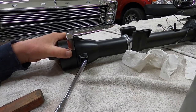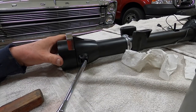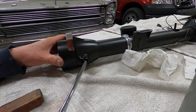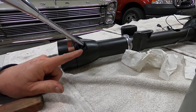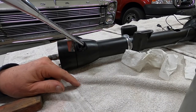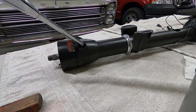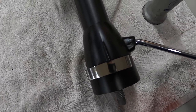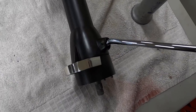The pointer is right on the money when it's in drive - right on the green mark. I'll adjust the transmission linkage so when that's in drive, the transmission is latched in drive too, so the pointer will be lined up from there on. I'm going to take my little Dremel with a cutoff wheel and whack that excess pin off, then touch those up and the steering column will be ready to install. Touched up the paint - this thing is ready to go in. Look at that, nice and tight - super happy with how it tightened up.